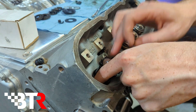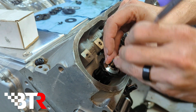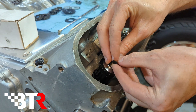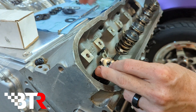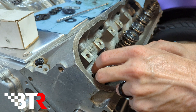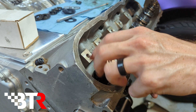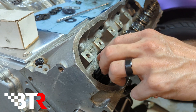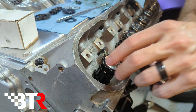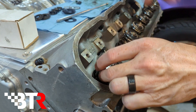So again, put that underneath. Tool on, which that's sitting in there. Grab your keepers, get those in there — before that drops back down, pin magnet, definitely. I'll turn around again and let's see what we have. So there's one, two times around, we're coming up on seven... there's seven, seven-one, seven-two. So now we've gone too far — now we're looking at 1.730. So that tells us we don't have enough shim in there.